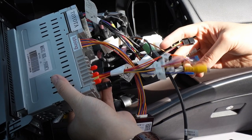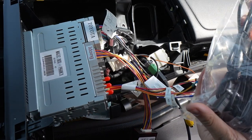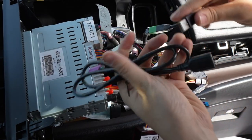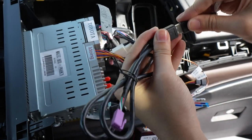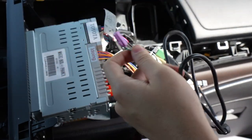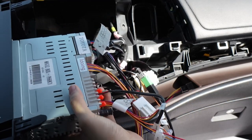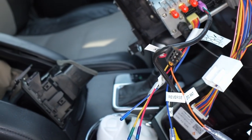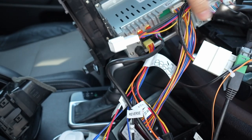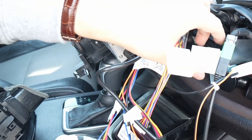We have keys and stuff like that which we don't have to worry about right now — reverse signal, amp controls. I just need to get the USB so we can test it. The USB adapter is the one with the green tip and the gray one — plug it into the Type-A plug. Make sure it's the right way because with old-school USB it only goes in one way. I'm going to use this purple wire — it's a 4-pin and there's a 4-pin right here.